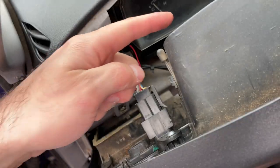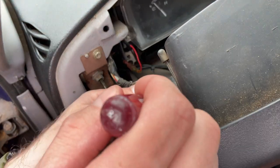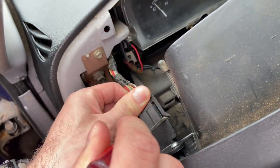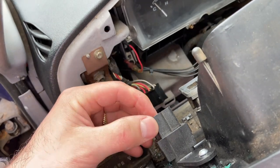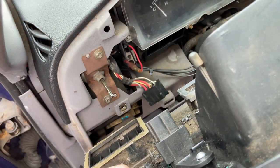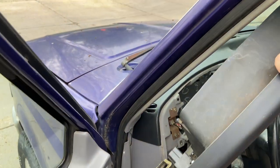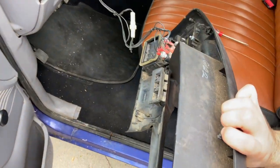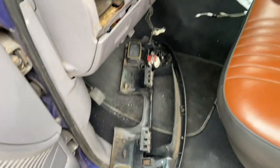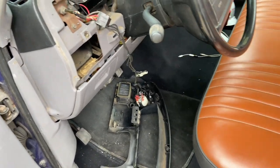I'm getting a little pull over here because the fuel selector switch is still plugged in, but I'm disconnected from this side. With your dash pulled away, here's the back side of your fuel selector switch. Reach back here with that little flathead screwdriver and pry up on this nice and gently. Whatever you do, don't pull too hard on this because these will break out and you'll mess that whole piece up. There it is — it's disconnected and your whole dash can now be pulled safely away. I still have my gauge wired up so I'll just leave it down on the floor.